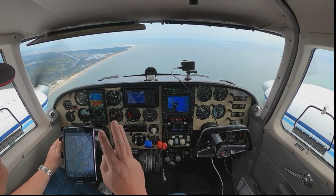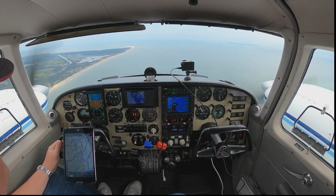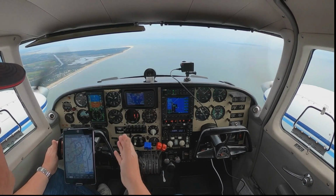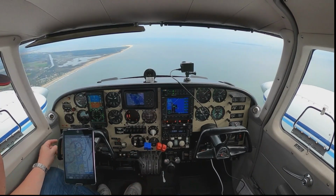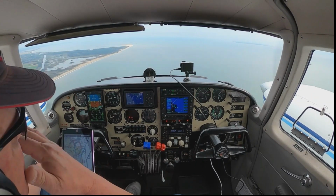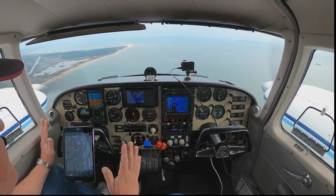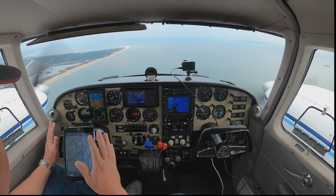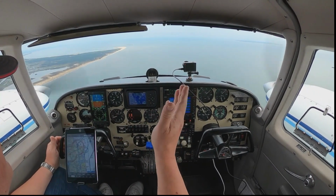And this reinforces another reason. So I've had three issues since I brought the airplane back. They've all been, in my mind, minor. You don't know that at the time. So this particular issue here, with CHT number 3, it's either a bad probe, more than likely, it's another loose connection. So I had a loose connection on one of the switches down here on the left electro-air control that caused the breaker to trip. And, of course, to lose that left igniter, I aborted a takeoff. Actually, I was holding short, and I decided not to take off until we got the problem looked at. When we looked at it, it was a loose connection. Prior to that, we had the loose connection on the voltage regulator.